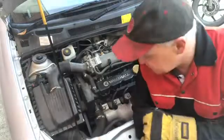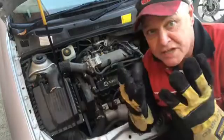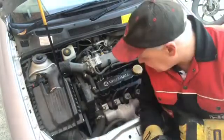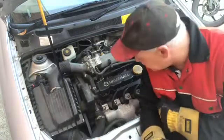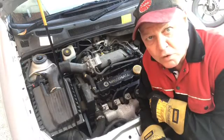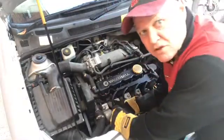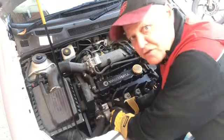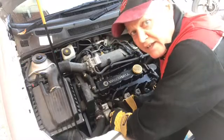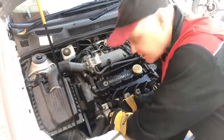This is not going to take long. We're going to do the ignition side — a very simple test. I've got insulated gloves; you can get special pliers but I've opted for insulated gloves. What we're going to do is take one spark plug cap off at a time. That's going to eliminate whether we've got a fault with the coil. What we're looking for is the engine to die — if it starts to die, that shows the coil is working. If it doesn't die and it carries on the same tone, that coil could possibly be faulty.